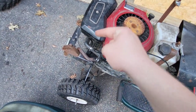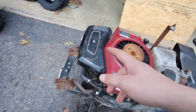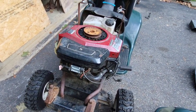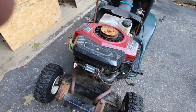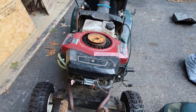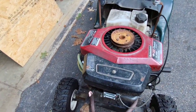Every time I tried to pull it, gas was shooting out of the exhaust. I thought okay, the carburetor's shot. So I drained the oil, put new oil in, bought a brand new carb, put it on — it's doing the same thing, won't run. I think it's not getting spark again because it's not even trying to fire, and that was like a $60 coil because I was tired of the cheap Chinese ones not working. So something is seriously wrong internally on this motor.